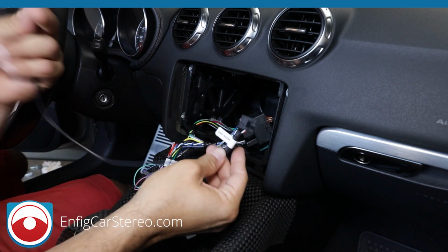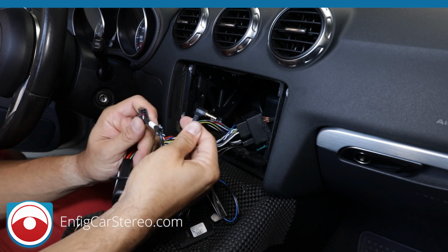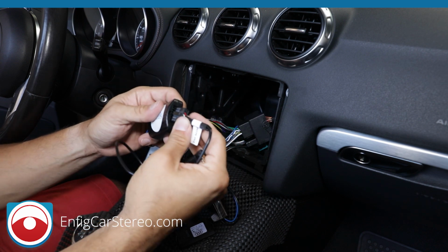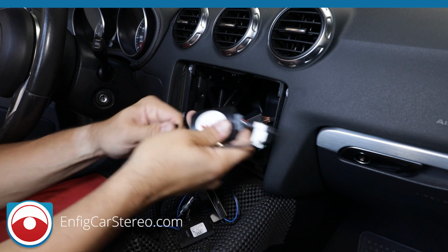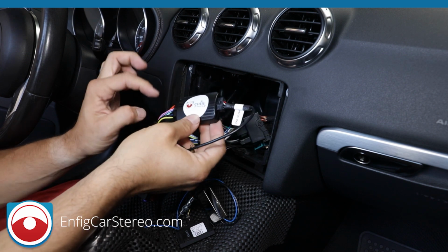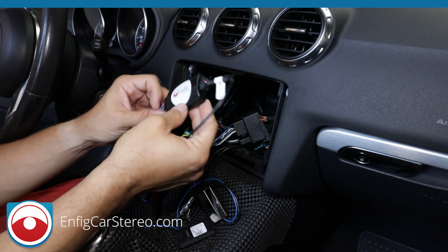This is an SWCL Sony. What this does is that it has the correct head for a Sony radio. And also these little loops that you see buried in here, they actually tell the box what radio it's on. So you're going to plug this in here. This is specific for Sony, and then you unplug it, wait 5 seconds, and when you plug it back in, now when this yellow and black touch the box, it reads the loops, and now it knows you're Sony, so you're good.